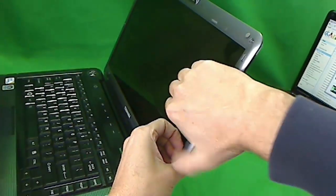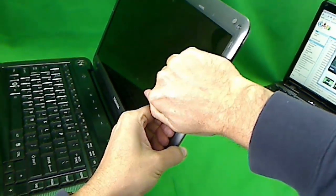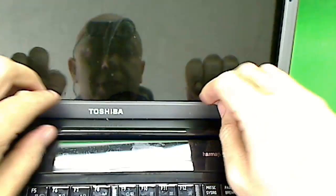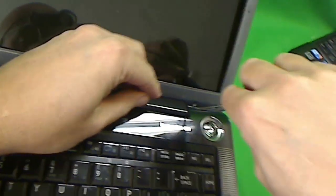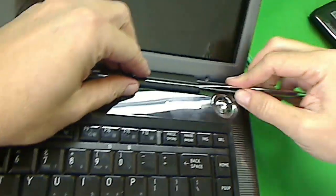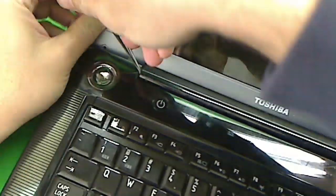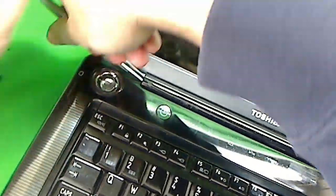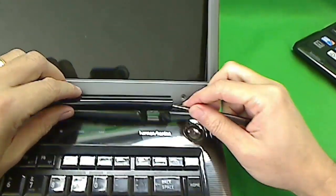Next, what I want to do is snap off the frame. I like to grab it by the fingernails from the screen side and start snapping — if you hear snapping, that's good. Now for the tricky part: the plastic frame has this piece along with it that also has to come off, and that's a little bit harder. Take the tweezers, go from the edge, and try to lift it up. The trick for this one is to take the tweezers and pop it up like this. And this is the plastic frame — remove it.